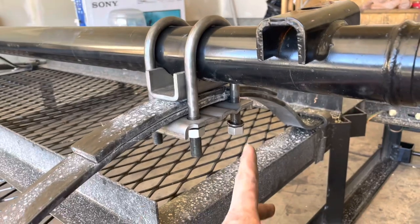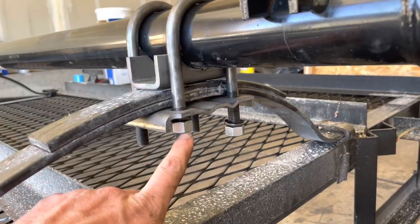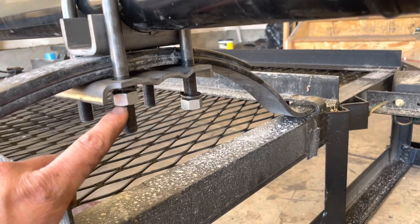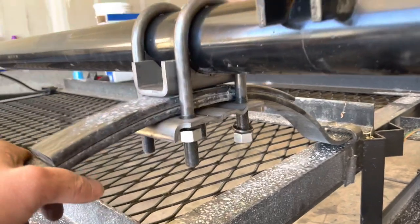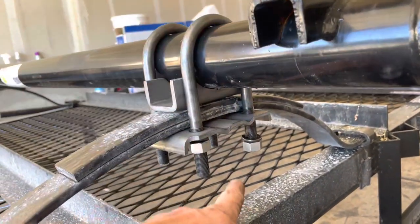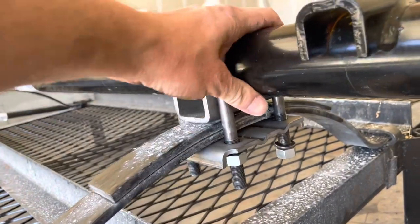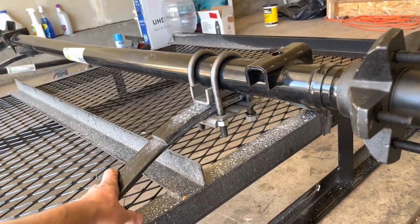When installing U-bolts, you want to keep the plate as even as possible so it's even pressure across the top spring. As you tighten these down, you want to make sure they're all roughly the same — if there's an inch of thread on this one, you want an inch of thread showing on all four. If one shows drastically more thread than the others, that means it's pulled cockeyed and it's not providing even pressure on the seat. It can also throw off your alignment a little bit. I know it's a trailer and alignment isn't nearly as important as in a vehicle, but it is still kind of important especially if you're going to pull it on the road a lot.